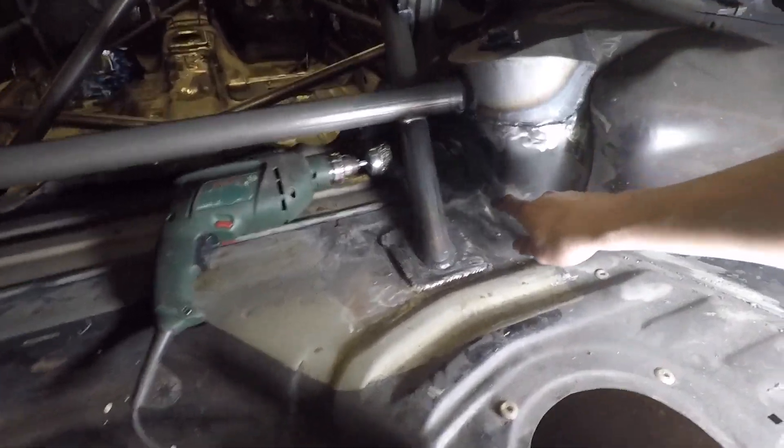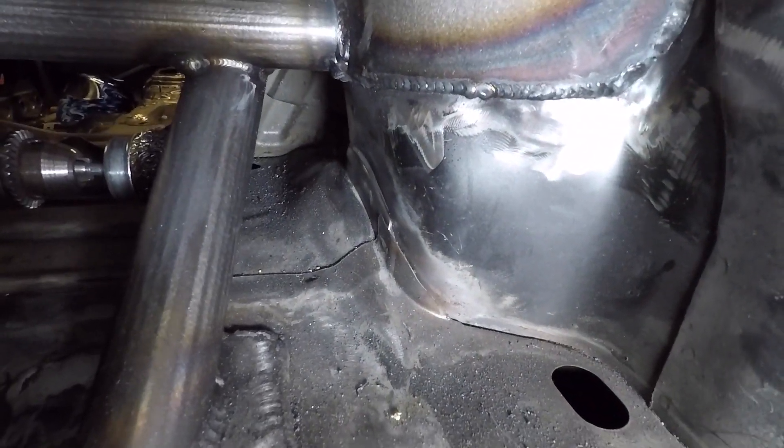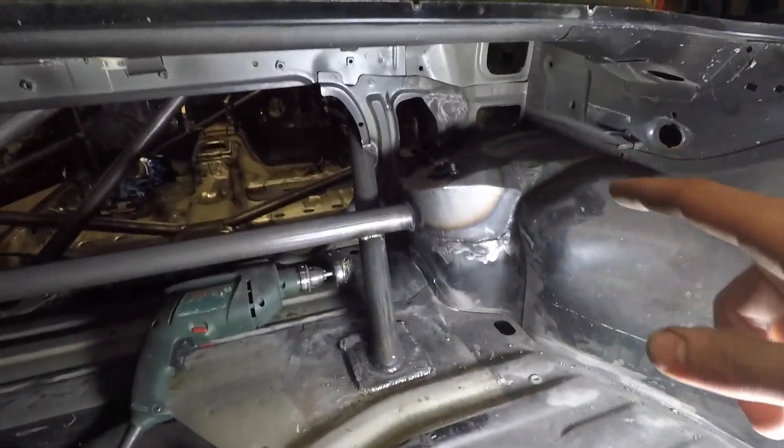At the moment I'm happy that all of the stitch welding is exactly as they would have done it. The boot was the bit that was stressing me out — I haven't really got any photos apart from the underside photo. I think the only section they did was just this small section around here, so just for me knowing it's done I'm going to put a little seam around there. But to do it properly you can see there's a small gap down here — it'll just look shit — so I'm going to drop off the rear coilovers.